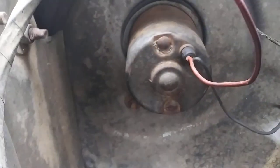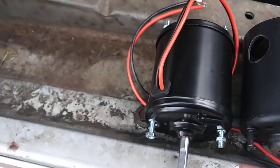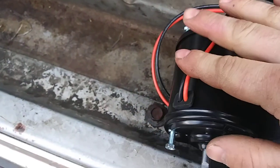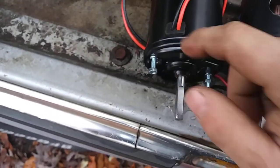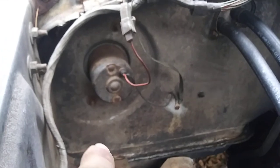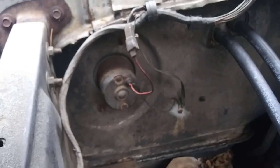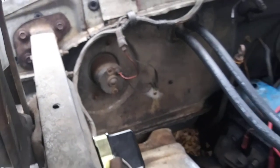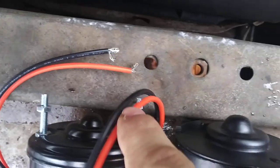Originally the wiring comes out on the front. This won't matter because I was worried about the wires having to go through the firewall and possibly rubbing and causing issues. But looking at it, the end of this blower motor is just about at the front, and the firewall is beveled inward a bit — so it should clear just fine and we shouldn't have issues.